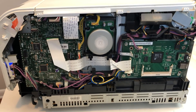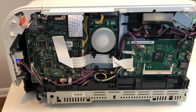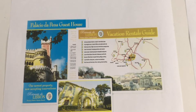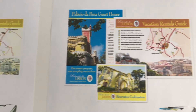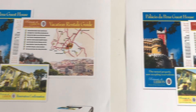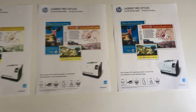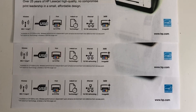Fired back up and getting ready for our first set of test prints. On the left is the test print before we cleaned — you can see how weak the colors are, especially the magenta. Here's after cleaning only the mirrors — look at what a difference it made. And with the mirrors and the laser assembly both clean, what a difference — so much bolder. You can do this. Be careful, take your time, and you can do it.